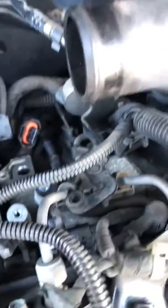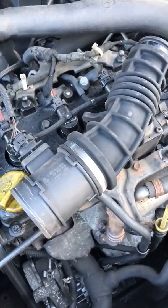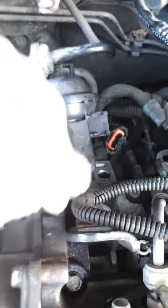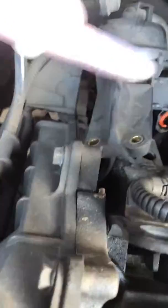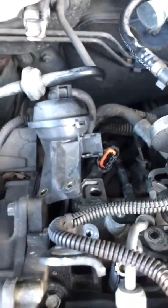I had to move the air duct — you can see it there, I've placed it on top of the engine — to get access to this part. I think that's the swirl flap actuator. You just have to ease it out of the way. There's a plastic bit right underneath it that's attached and it's not going to come out, so just move it aside. This is the location of the MAP sensor — just there in that gap — and in there there was a lot of carbon buildup. It's part of the intake, so I've just sprayed some carb cleaner in there. It was extremely mucky.